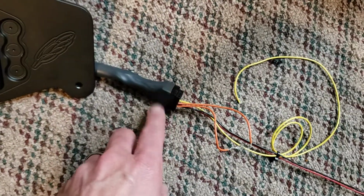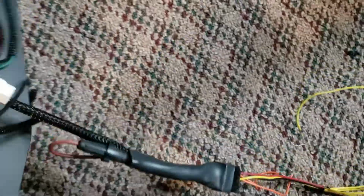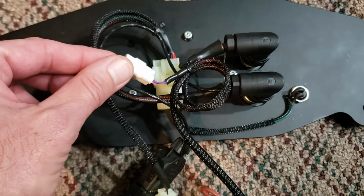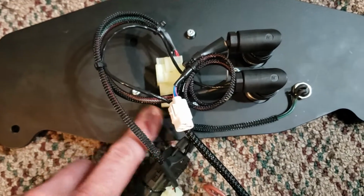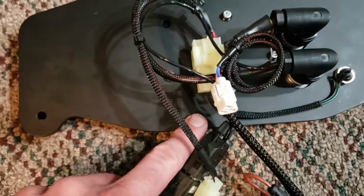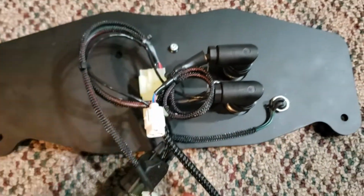And then you also have plug and play dash connector here, which I just have that plugged into a power supply. And then on the back side, you got analog 2, 3, and 4, which none of those are being used because we're doing everything over CAN, but I wired those up for you. And then back here, basically there's just a ground, and then the up button is wired, but I've got everything else, 12 volt ground, menu select, all that stuff is wired to this connector if you decided to expand in the future.